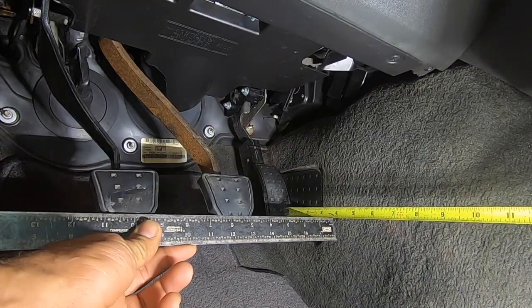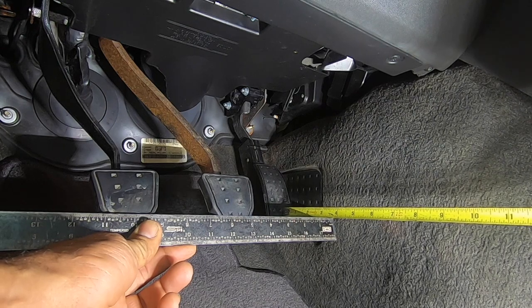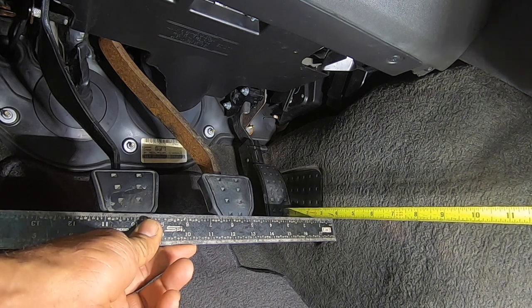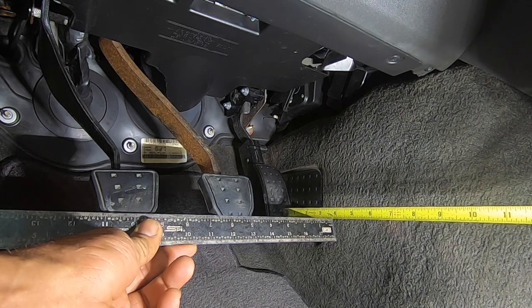This is the challenge we have in trying to do heel-toe in the Cadillac CTS or the Cadillac CTS-V. How far back is that pedal, Fonzie? It looks about 2 and a half inches. So it's 2 and a half inches back, and what we want to do is raise the accelerator pedal not fully into the same plane as the brake and clutch pedal — that might make it a little bit more uncomfortable to drive. But we're going to move it back about an inch and three-quarters, and that allows someone with an average-sized foot to be able to dive into the brake pedal and blip the throttle at the same time.